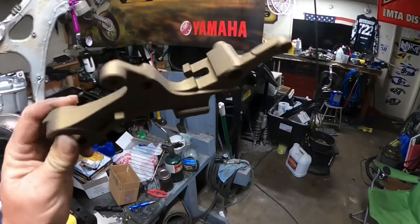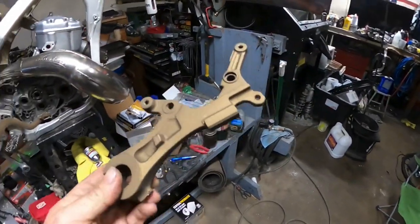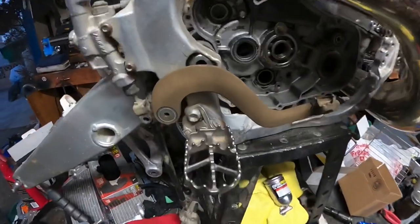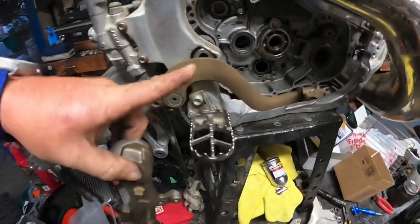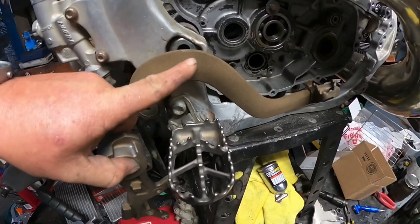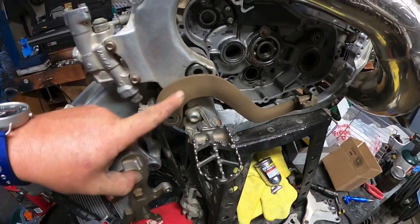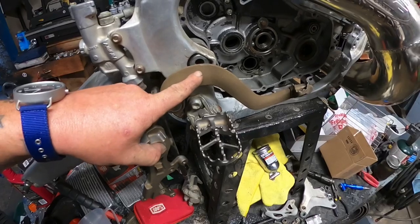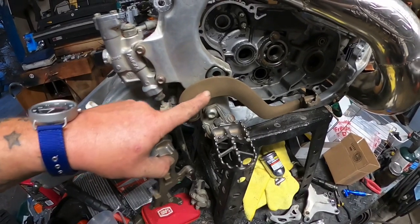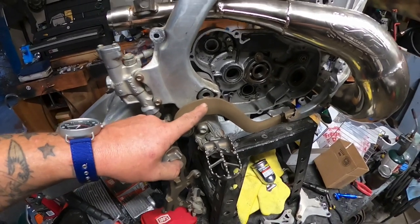So, I highly recommend that you guys do not do these in a toaster oven, although it works. So, let me be clear about this. Here's a brake lever too, right? Came out good. However, I did spray it on too hot, so it's got an extremely chalky finish to it. Almost feels like a chalkboard. I sprayed this part too hot, and it made it react bad. So this I'm gonna vapor hone back down and do it again.